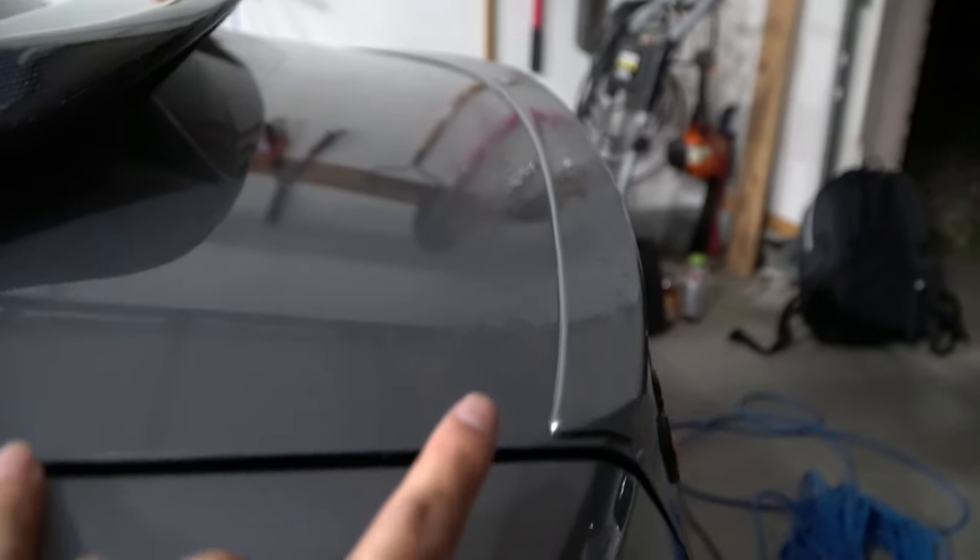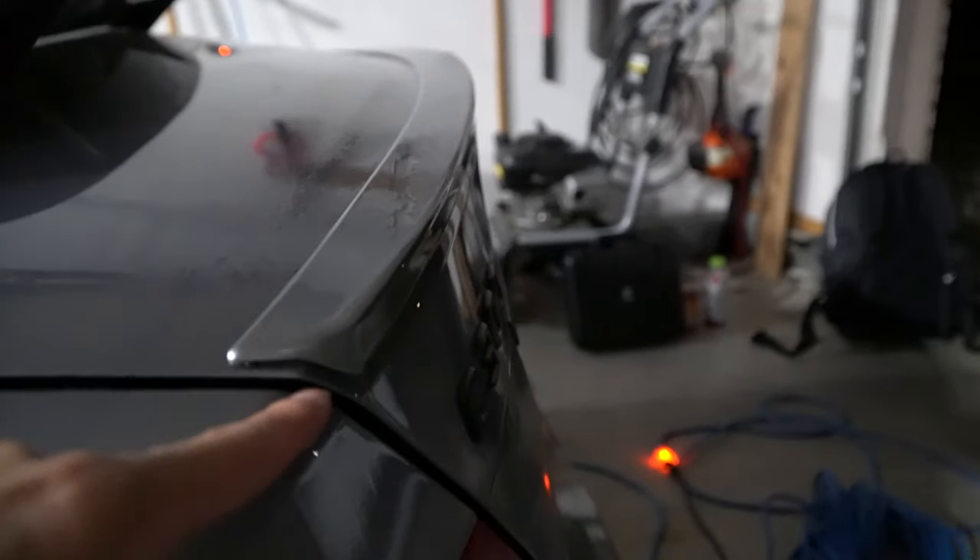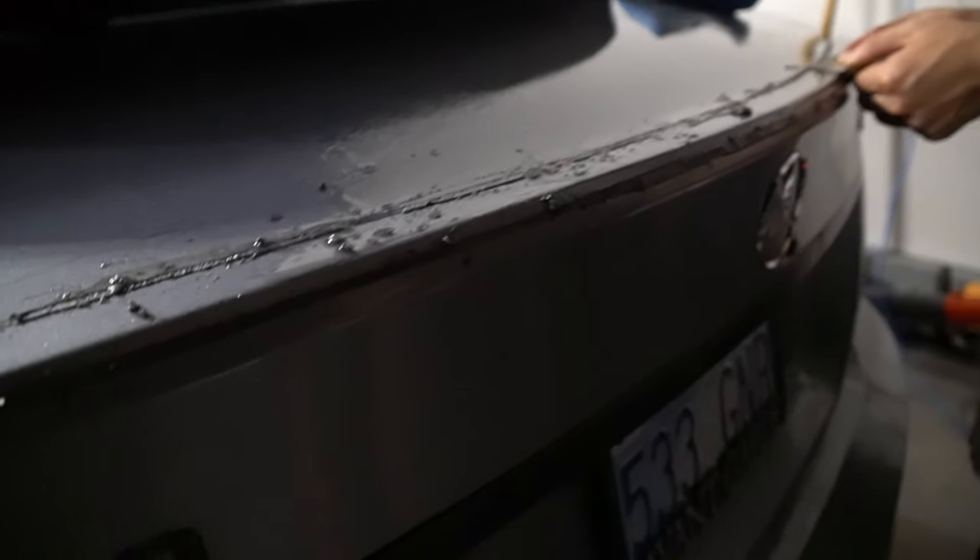We'll do the full details on his car in another vlog. We're going to go ahead and get my stock OEM spoiler off. As you guys can see, we got a little Goo Gone - we put some Goo Gone on that, and we're going to be using a fishing line trying to get in between the cracks. This is one of the main reasons why I did not want to get a duck bill or any type of rear spoiler - I knew I was going to have to deal with this. Look how bad that is. This thing is like stuck on there, we've been at this for like 30 minutes. We have the top one up here and the bottom one down here. Car is life, so you know, might as well.